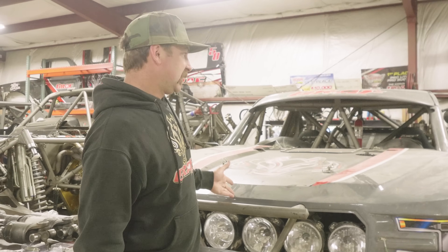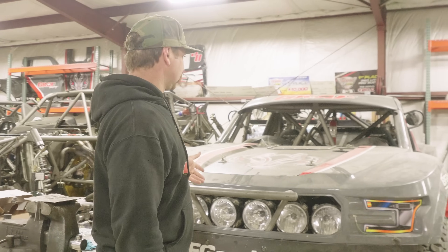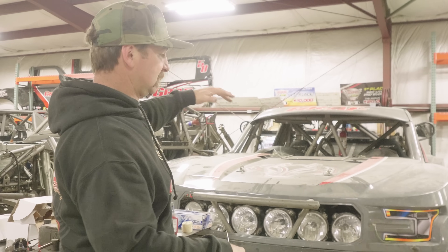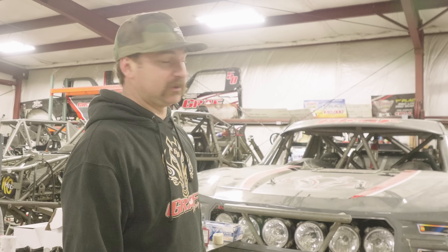So there's your first encounter with Tom, our body guy. Basically what we had to come up with is — we didn't have our spindles in time to figure out where the body needs to be and how wide the hood needs to be. So we took some drawings and measurements and just winged it. We guesstimated we need to be three inches wider, cut straight down the center of a brand new hood, widened it three inches, and fixed and filled in all the fiberglass. The plan is to keep going so when the spindles arrive, we're not two weeks behind.